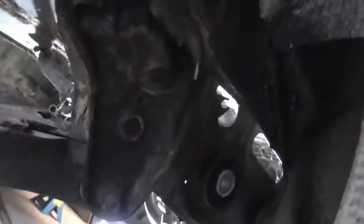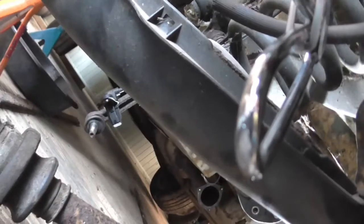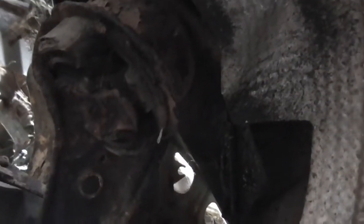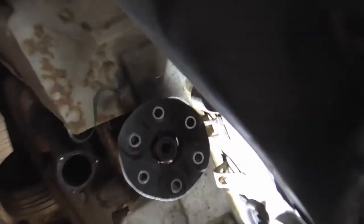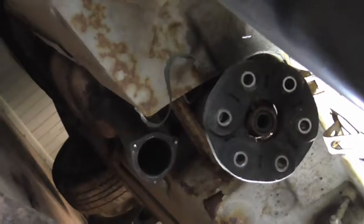So that's a good one — this is where I wanted to be. The next job is probably releasing the springs and shocks, and seeing what hydraulic lines are connected to this subframe — hopefully they're connected to the car rather than the subframe. I can see the ABS cable is connected to the subframe, so I have to release all that. Then we're going to go with probably two trolley jacks under this, release all the bolts and lower it down, and get it out from under the car. We are really starting to get somewhere.